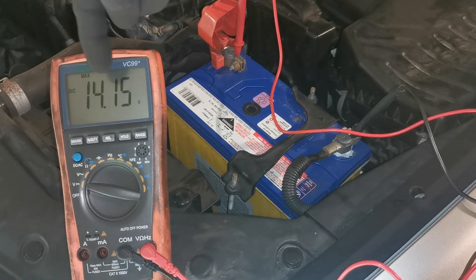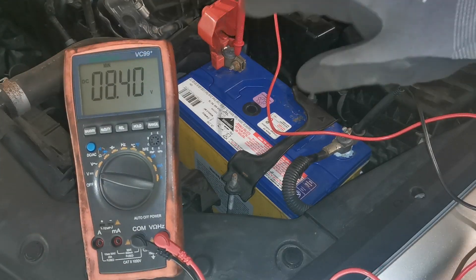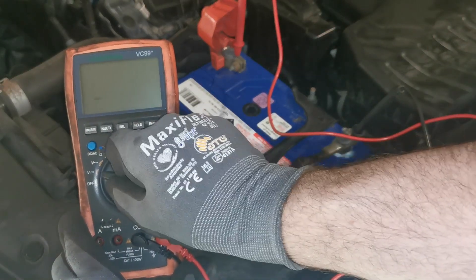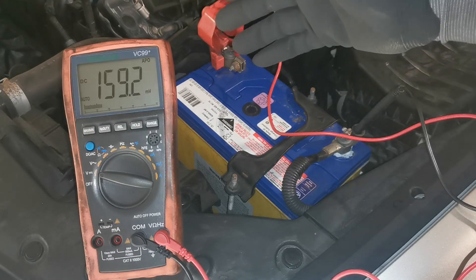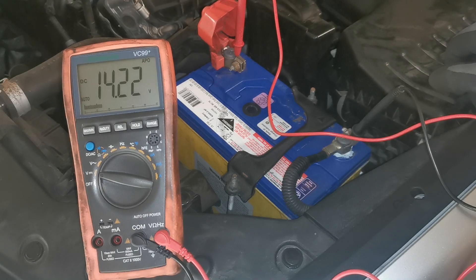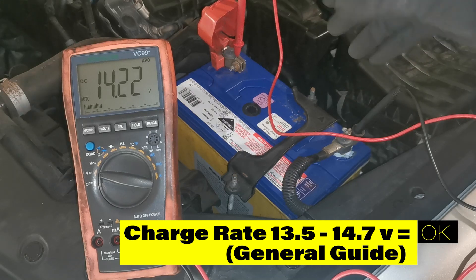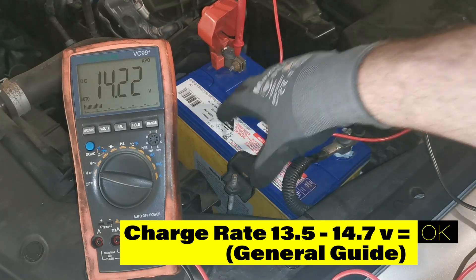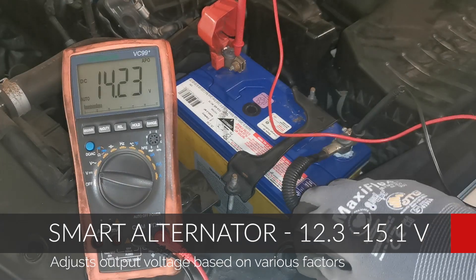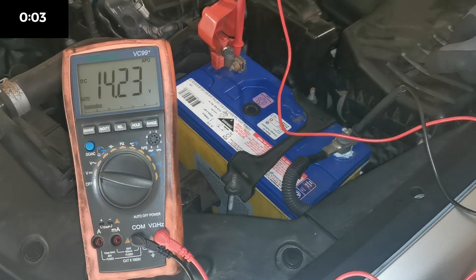We have a high voltage of 14.1 — going to minimum, it's 8.4, which is below the 9.6 we would want. Selecting the current charge rate, we can see 14.2 volts currently being pumped in to bring the battery voltage up. That shows a good alternator charge rate — 13.5 to 14.7 is typical on an application like this without a variable voltage alternator, so we're happy with that reading. We're not happy with less than 9.6 volts, which shows an issue with the battery.